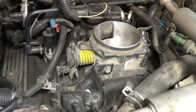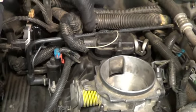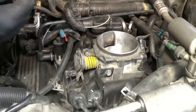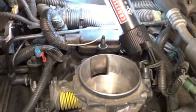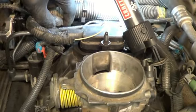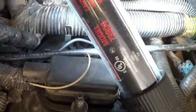Okay, obviously it ran pretty crappy when we first started it. What we figured out is that pulling this wiring harness off we popped the map sensor out of the manifold, so we had a huge vacuum leak. We'd noticed in some previous work that basically the gasket on that map sensor was in pretty crappy condition, and it didn't stick in the hole very well.